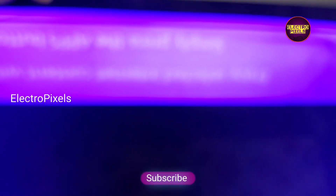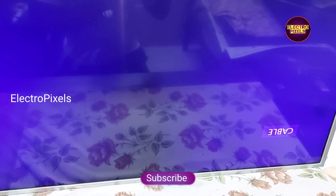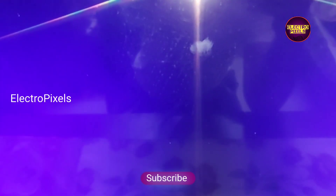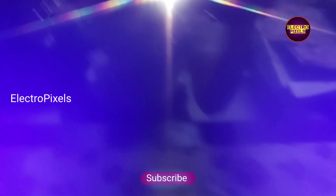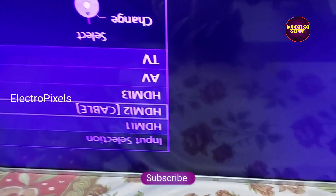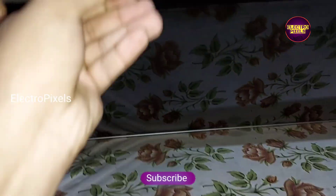The picture has come back and the complaint is solved successfully. Remember, this is just a temporary solution — the permanent solution is panel replacement. There is still a blue color tint issue in this TV because of the backlight, so to get accurate color we also need to replace the backlight. At present, the panel has been repaired by removing the shorting from the left side gate signal by masking it using the taping method.